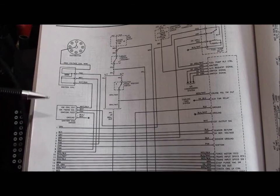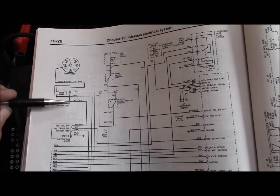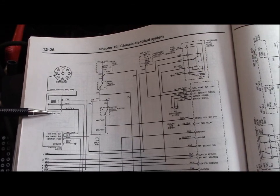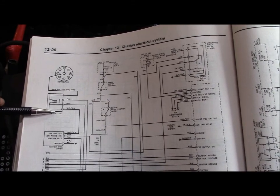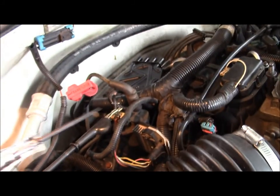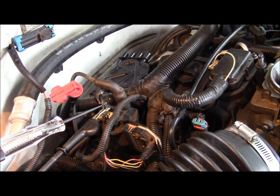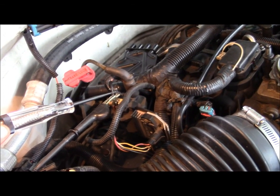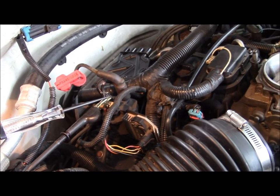They all match. So what they want me to do is go to the white and black terminal at the ignition coil with a test light to positive. Okay, I've got multiple things set up there. And then to take the test light to the pin here and crank it and check for modulation of the test light. Now what I've also done is set up the Vantage.